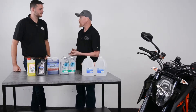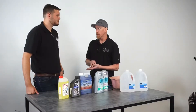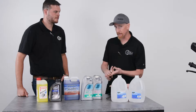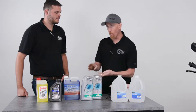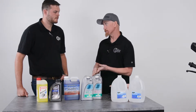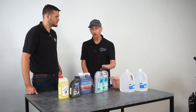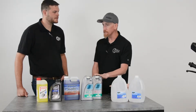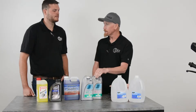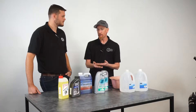Depending on the type of bike you have, you may have a reclaimer, an expansion tank, or a fan. It's important to know that those also get drained whenever you're flushing your coolant or switching coolant types — whether it's ethylene glycol, propylene glycol, or water wetter, which has no glycol and is required by some racing sanctioning bodies. If your cooling system has no glycol and no freeze protection, remember over winter to put something in there to prevent freezing and avoid costly engine damage.